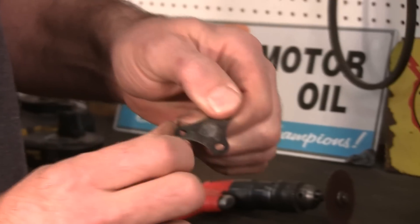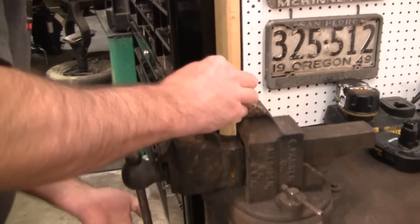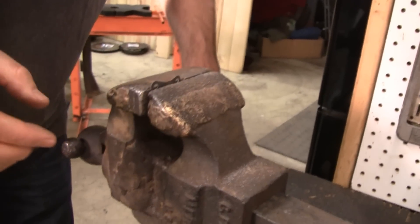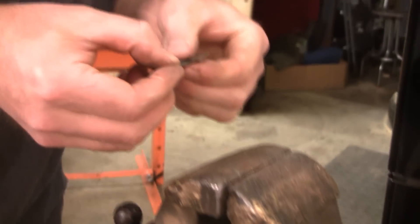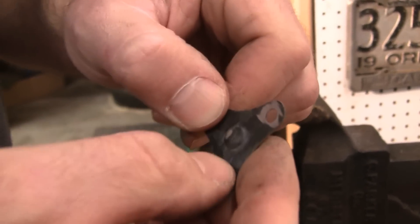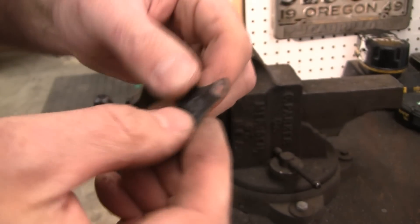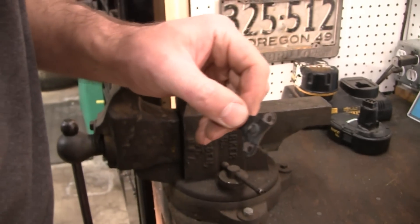There you go — there's your socket that showed excessive wear. All I'm going to do is munch this a little bit. All I did was just barely take the crown out of this, but at the same time when I was pressing down, these ears were pushing out. So you're causing more resistance by pushing this further in towards the socket.